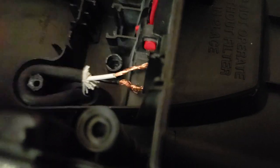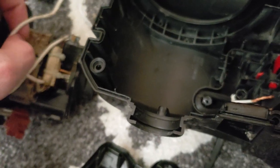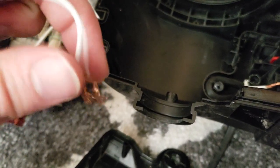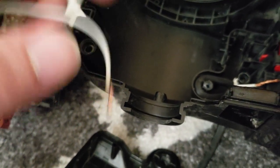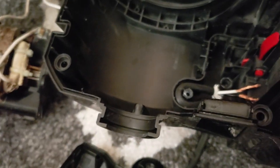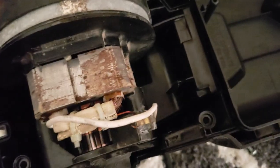We can try to feed these wires and try to attach them. And it's pretty self-explanatory, like I said, just attach the wires, twist the copper together so they're actually intertwined. Electrical tape them off with a little bit of electrical tape, and then screw the cap on the end. And so I'll do that real quick. Again, it's kind of hard to show that.